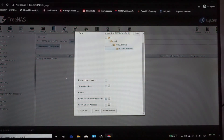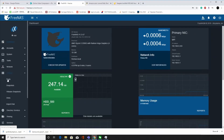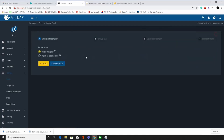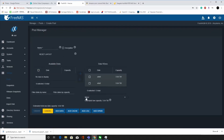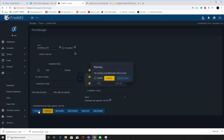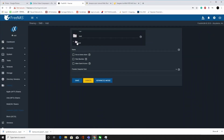If you want to add a redundancy data configuration or a RAID zero configuration for your NAS, go to Storage, select Pool, and then select the two disks you want to configure. If you want to add redundancy to your data storage, use Mirror. If you want to gain speed and storage size at the same time with the trade-off of higher data damage risk, select Stripe. Give it a name, select Create, then follow the same steps to share the storage you just created, and you're good to go.